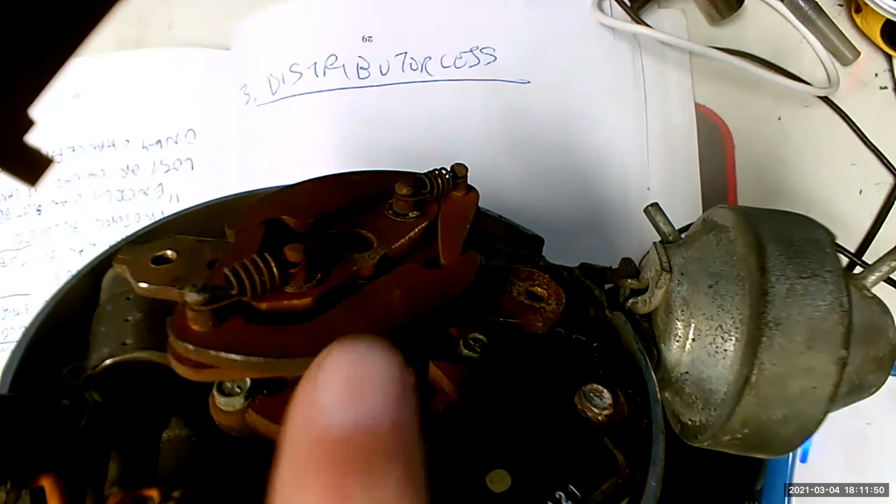the big problem that made this so important is, as engine speed increases, spark gets weaker. Now, is that a big problem? Yeah, it was a big problem, because when we had one coil, back like our drawing here, when we had one coil that was serving 4 cylinders, we didn't have much time for that.